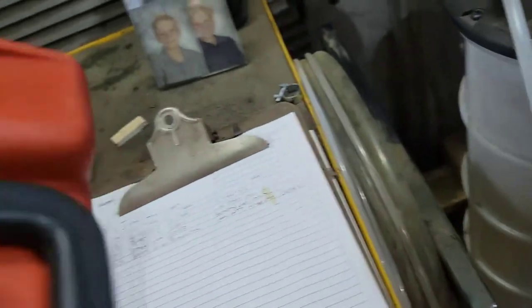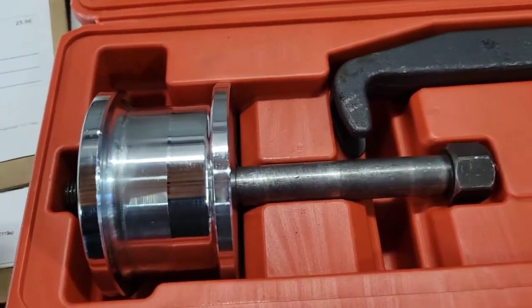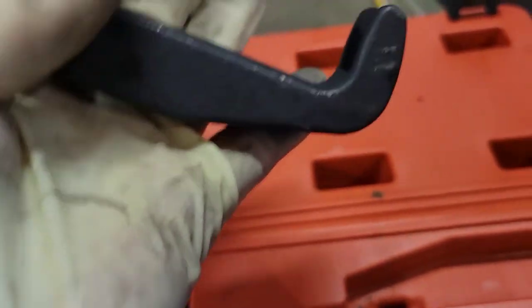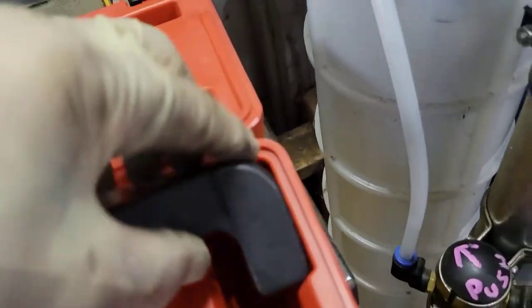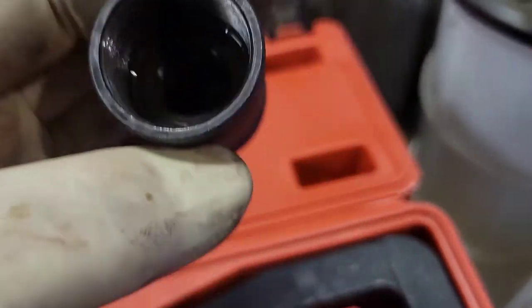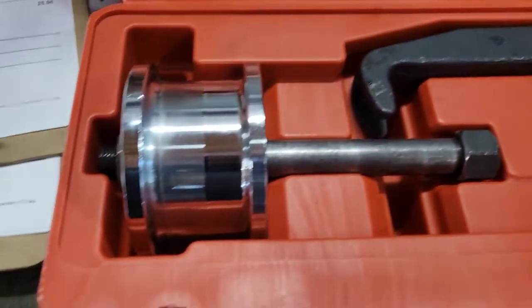Here's how it works: this puller right here goes in the bottom of the injector, hooks up underneath, and screws in there. Then here is the adapter for screwing into the top of the injector once you take the solenoid off. This kit got it done. The rod is about six and a half inches long — if you wanted, you could make your own slide hammer with a bolt and a weighted adapter, or find a nut with that very fine thread pitch. But this kit probably costs about 60 bucks.